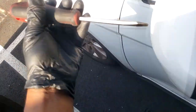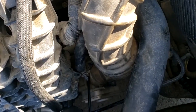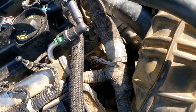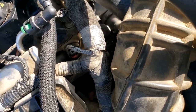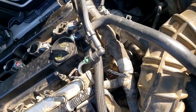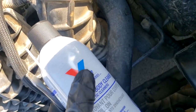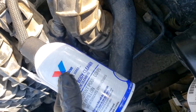I went upstairs and got my screwdriver to remove this intake hose — I'm about to simulate fuel presence. Some people would hook a fuel pressure gauge right there, and you can go that route too. A fuel pressure gauge is the proper way to do this — it lets you monitor your fuel pressure level. But I don't have the connections built yet, so I'm going to spray fuel down there and simulate fuel presence. Let me get this hose off and we'll see what happens.